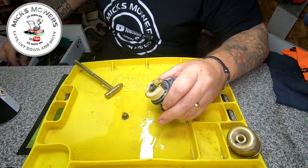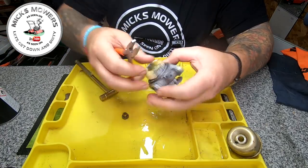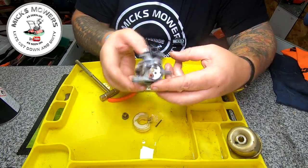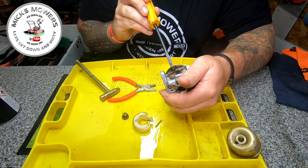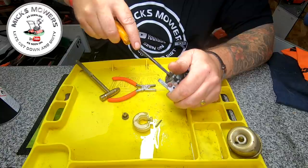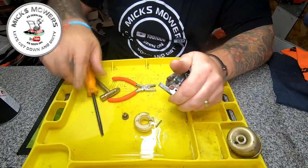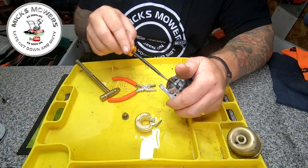I've got a little tiny pin to remove for the float. Up comes the float and needle. Over this side we'll have the little tiny mixture jet. It's at around about quarter past — so I'm just going to count those turns out. That's one half turn, that's a full turn, that's one and a half, that's one and three quarter turns. Remember: one and three quarters.